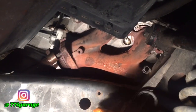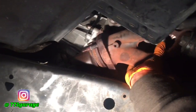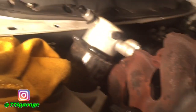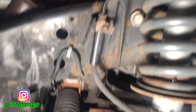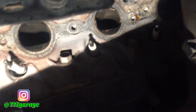I managed to remove the other bolts without breaking any more. After about 20 minutes it's almost out — this side's done, just a little more pulling. You do have to move the condenser a little bit; you have to unbolt it and wiggle it through. Don't forget to take the dipstick out of the oil pan either. This side's done — now I just gotta focus on that stud that's stuck in there. All the other ones came off without any issues on the passenger side.